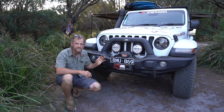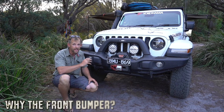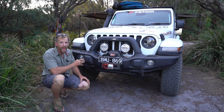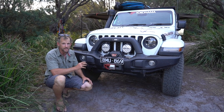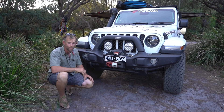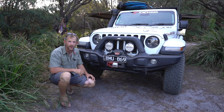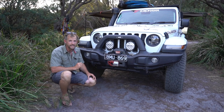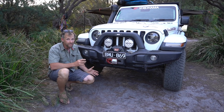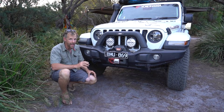At the front of the vehicle — this is a bit more four-wheel-drive focused, but these things are important to consider. Hitting a kangaroo is a very big concern here in Australia, so I chose a steel bumper from AEV. These guys are the best of the best. I had their bumper on my previous Wrangler and after years of abuse in Africa it still looks as good as the day I bought it. It offers strong radiator protection and even has a skid plate to protect the steering components — the best all-in-one integrated solution. It also hides the winch nicely. Whatever bumper you pick, make sure it's legal in the countries you're planning to visit — a stubby bumper or a front stinger here in Australia is totally illegal.